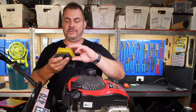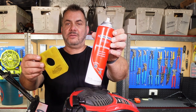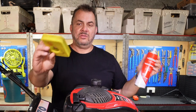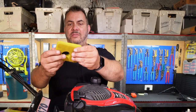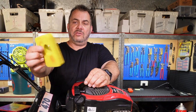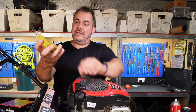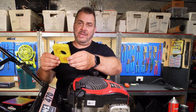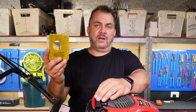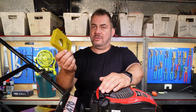On this side here is the air filter and it's just got a foam air filter with a cover on it. I'll use some brake cleaner — you can also use degreaser or any other cleaning product to spray onto the foam. I have cleaned the foam, rinsed it with water, and dried it. It is now dry and ready to reuse. Now if you notice that the foam is starting to deteriorate and fall apart just throw it out and buy another one. It's not worthwhile having bits of foam going into the carburetor of your lawnmower. This one here is still perfect so I'm going to reuse it.